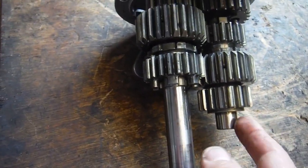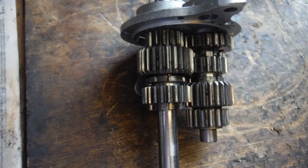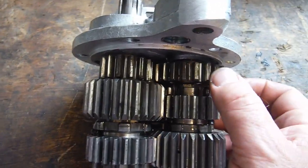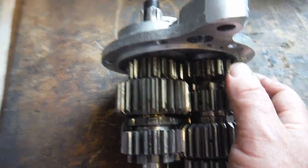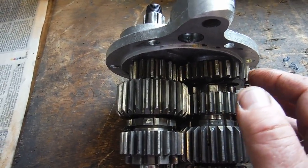With a replacement for the missing thrust washer, we can probably put it back together and find there's no more noises and no more whining in first gear. But that's people getting up to all sorts of things when they put these together, not necessarily knowing what they're doing or whether they're using the right parts — and clearly that's something that's happened here.